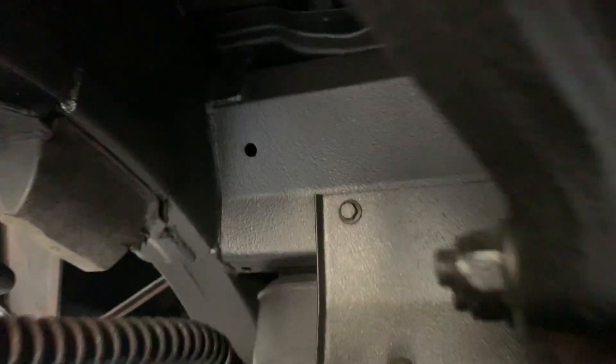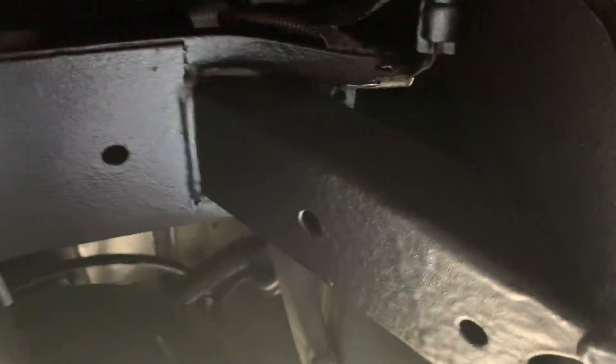These bolts are re-blacked for the back of the shock brackets after they're refitted. This is all cavity treated up through these holes here, here, and here. Floor panel is done as well — there are steel braces so ideally you should rust proof them, again not as prone to corrosion as the other parts but still a bit of an issue. That's where the A-frame mounts up to the chassis — it's your central welded-in crossmember, a very complicated bit to do properly. You've also got another welded crossmember which you can access with a lance up through here and right across to treat the insides. We find the PCL lance is the best we've used — it's got a dual tube which creates a nice vacuum and gets lots of paint through it. We even try to get the brackets for the crossmember.